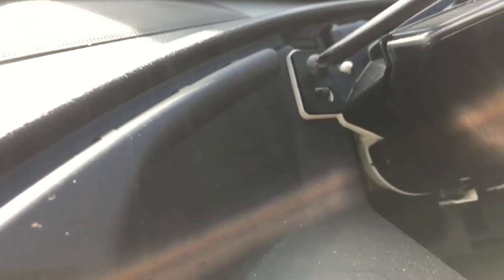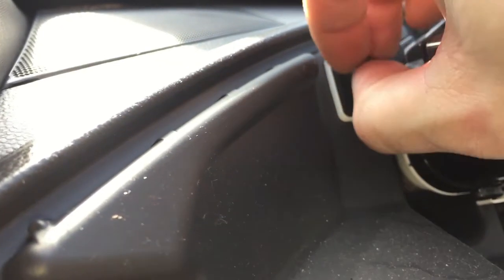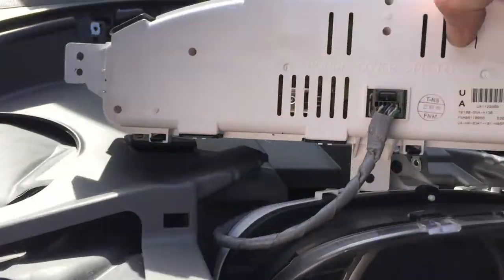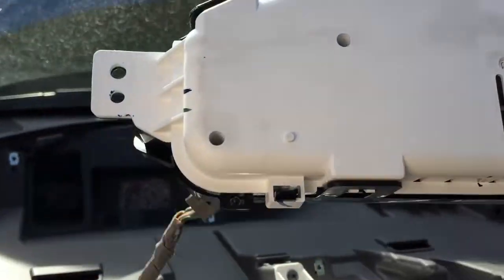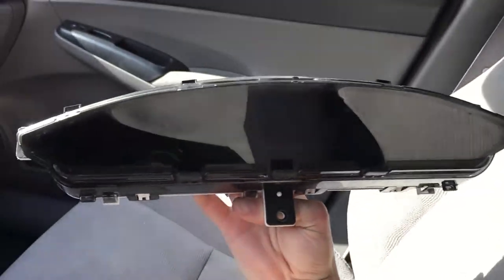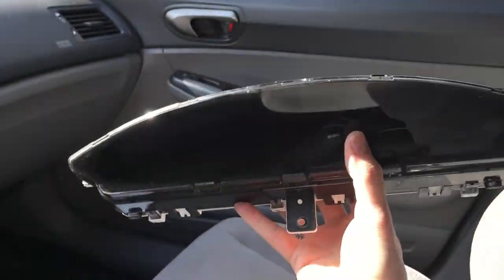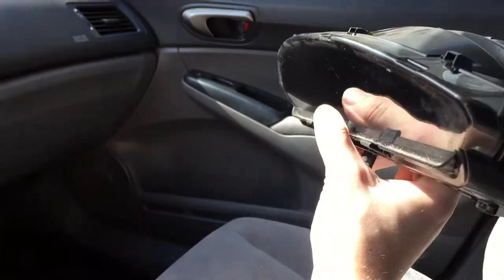I apologize — I am trying to film and do this myself and I know the sun is glaring, which is not going to be a great video, but it is definitely usable for anyone looking to do this by themselves. Now that we've removed the screws, simply pull the cluster forward, disconnect by pressing this button in, and there you have it. This is the upper cluster removal for a 2006 to 2011 Honda Civic. This particular model is an LX, but this works the same for LX, EX, Si's, and hybrids.